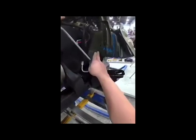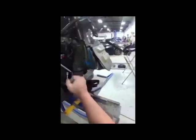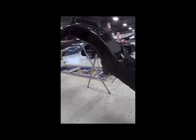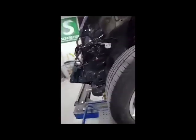They actually have a sectioning procedure on these. They have a line mark right here where it gets sectioned in at. I have the new rail here. You have to buy the whole piece. They don't sell just that front section, but luckily they do have a procedure to stub that front piece in. So I'm gonna go ahead and put this one in clamps and make some pulls and rough this out, and then I will start cutting it apart.